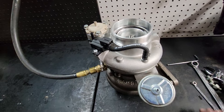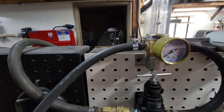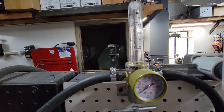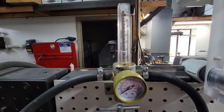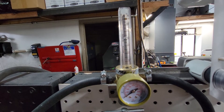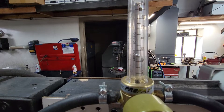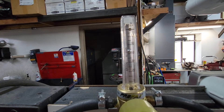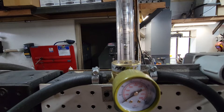I've got the fittings swapped over to our new EFR. The first thing we're going to notice is that the static reading when I first hooked it up is a little bit lower, but I found that this doesn't necessarily give you a good indicator of the overall condition of the turbo. So we're going to push and pull on the thrust load. This one's a little picky because it's full of assembly lube — a little thicker oil than normal. We're at just a little bit over 45 cubic feet per hour at max, and just under 15 cubic feet per hour minimum.